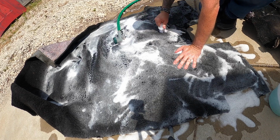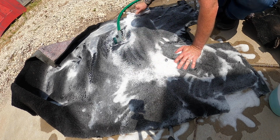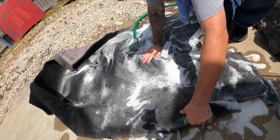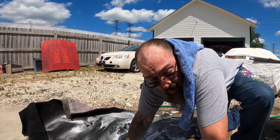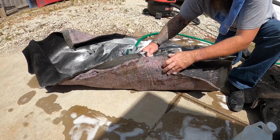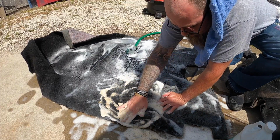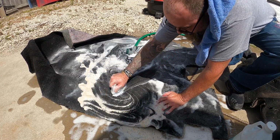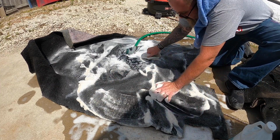dry out your carpet. And a lot of people think that your floor pans, the steel, will rust because you got all this water sitting on the carpet and the padding that's underneath the carpet, which, oh, knocked you guys over. Oh, party foul. Sorry guys. I got soap on my hands. Angle you guys down here, but they think that when you get this padding wet, it's not going to dry, and it's going to sit against your floor pans, and your floor pans are going to rust and rot out. That's not true at all.